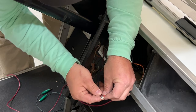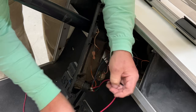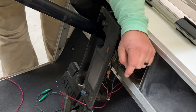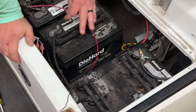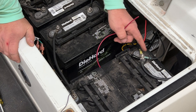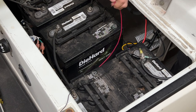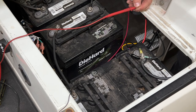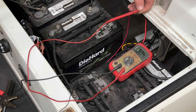I'm using some 14-gauge wire, putting a ring terminal on it and hooking it to the same terminal as the output of the key switch. It looks like somebody already did something similar — there's a red wire on there — so I'll hook both the blue wire and the red terminal up with that same screw. I've cut about six or seven feet of wire so we can run it back through the dashboard, underneath the golf cart, and up into the battery compartment. Now I've run the wire and it's here inside the battery compartment. With the key off there's no voltage; turning the key on jumps to 50 volts; turning it off drops back to zero.